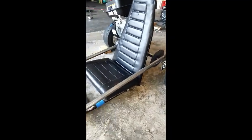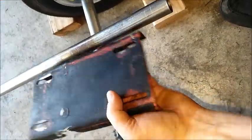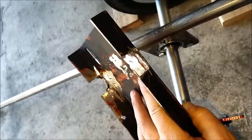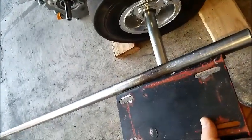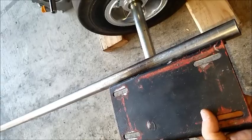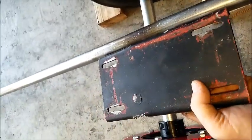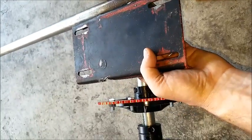I really didn't have to cut that much off the first frame — this is my first one. I'm going to go ahead and cut off the original motor mount, cut off the brake piece, and reuse that. I'm going to mount it right here on top. I got the original plate off and I'm going to mount it back here, then take advantage of these already-existing slots and put a cross beam going straight across. I'm not sure if I'll weld the plate to that cross beam or just weld it on the edges, because I want the motor to be right on top of the sprocket to make the chain as small as possible.